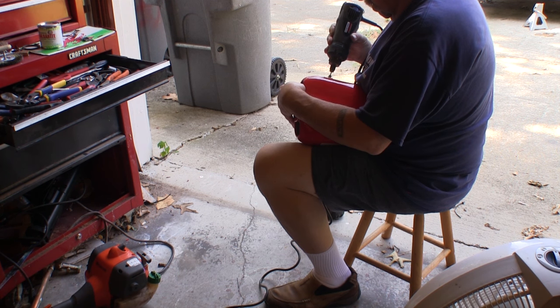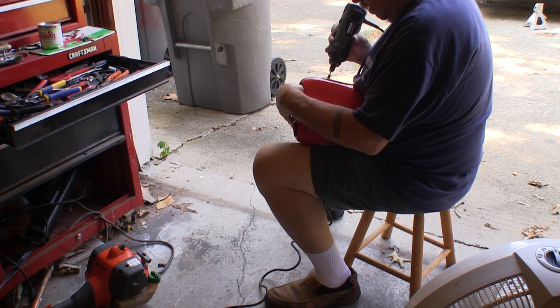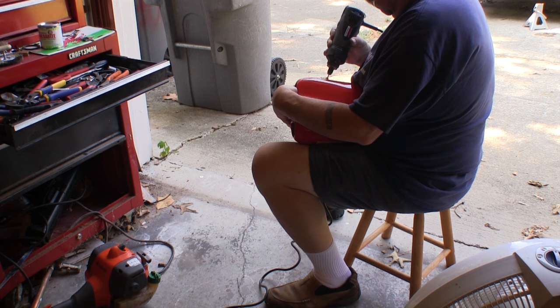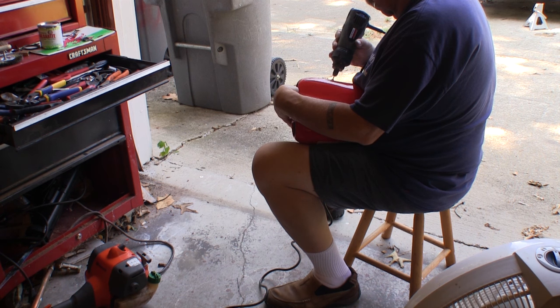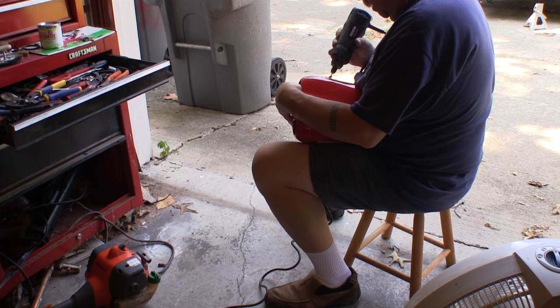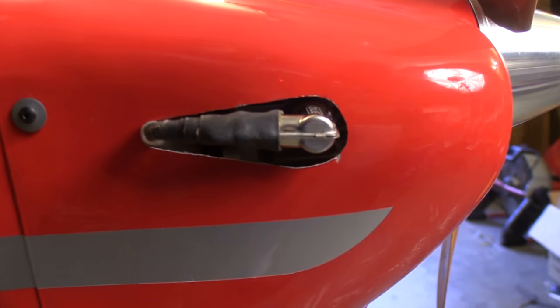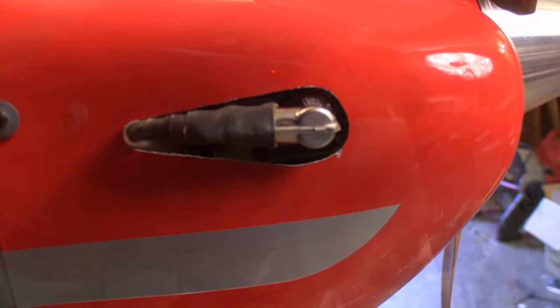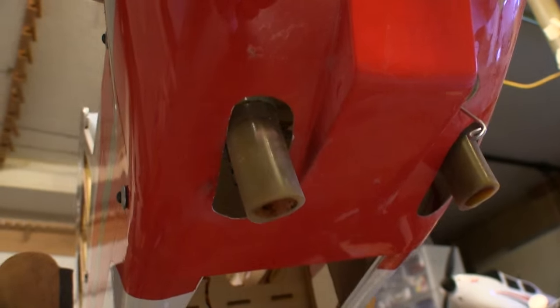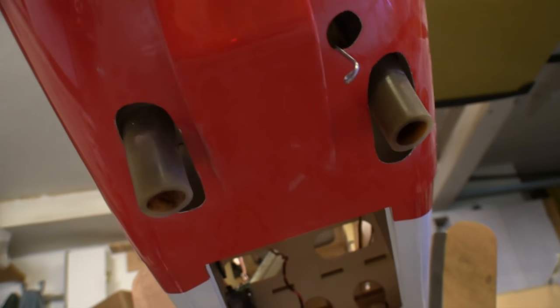When it comes to actually cutting the openings, nothing beats a good rotary tool, a nice sharp bit, and taking your time. I used to have to put these cowls on and take them off several times before I got the fit just right. Using this system I had two minor fit problems when I first put the cowl back on — it's easy to clean those up, and the next time I bolted the cowl up it stayed on. Now instead of people making odd remarks about my cowl jobs, they ask me how I did it. If I can do it, you sure can — just take your time and all will be fine.